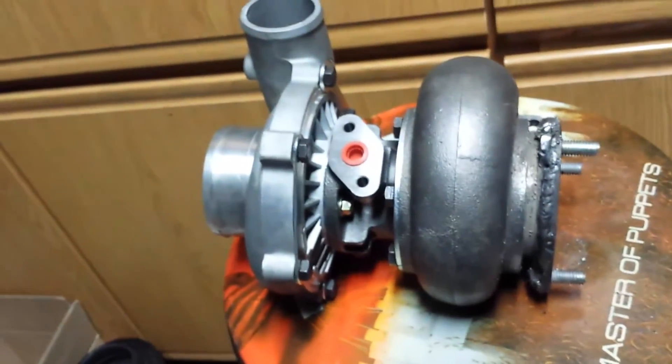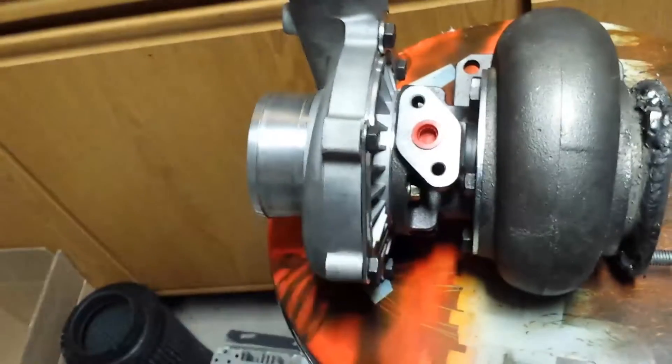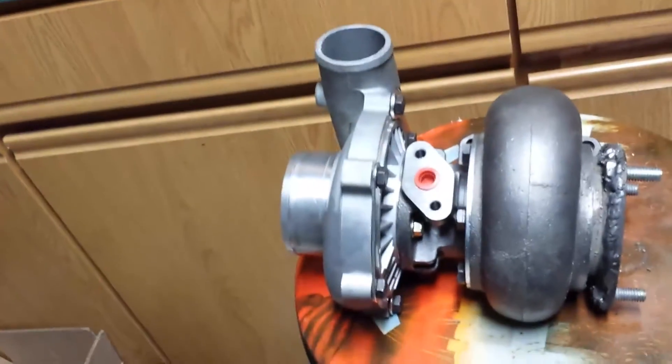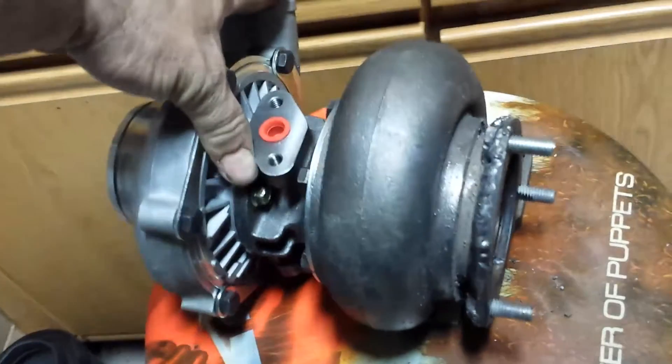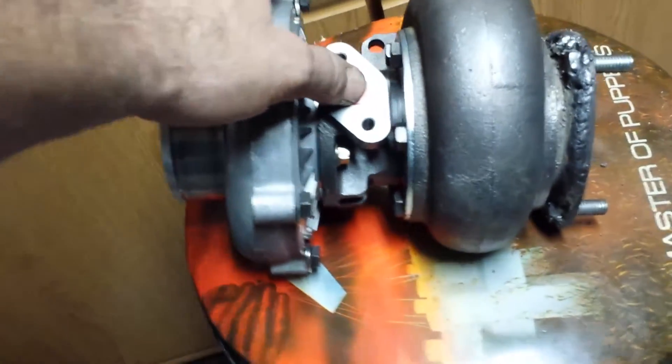Getting a little closer. I've got to make the flange for down here, or go buy one. A gasket came with the turbo, but the fittings for the oil — they're not a flange that goes on there, and he didn't have any, so I've got steel and I'll just probably cut my own with the plasma cutter. Other than that, I'm pretty much ready to start fabricating the exhaust to this — I just have to make up my mind exactly where I want to put it.